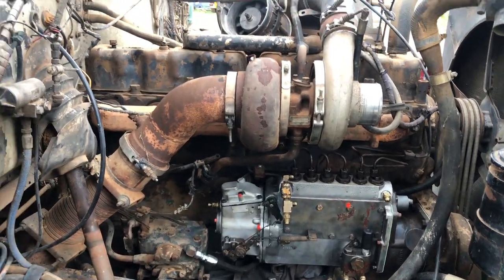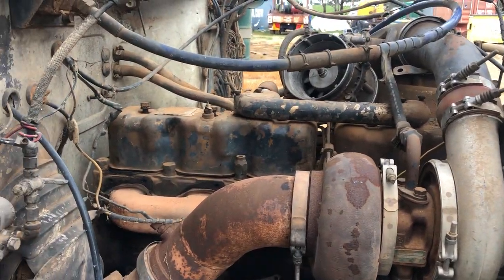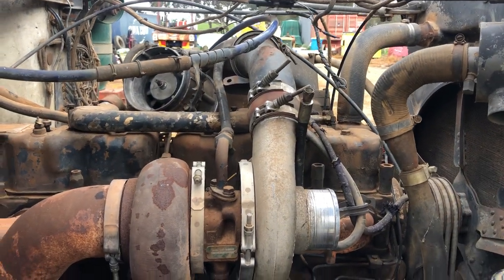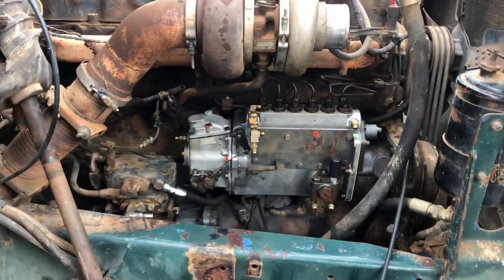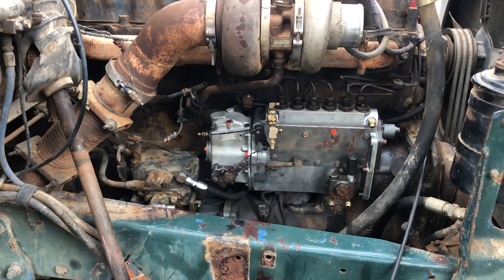The green, white and yellow is the last paint job — I've just given it a little buff on the cab door and the air cleaner. I'll do the rest of the sleeper cab once I've got the engine running right and give that interior a clean up. For the moment, we'll concentrate on getting this injector pump tidied up. I've also got some tappet cover gaskets here, so I might just peel the lids off and run through the valve clearances, reseal the lid gaskets and have a bit of a look around the top end.